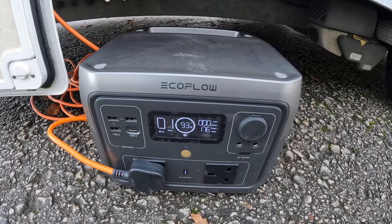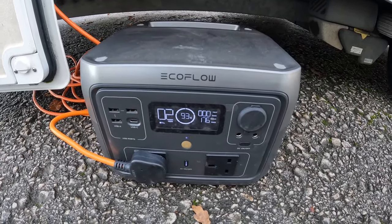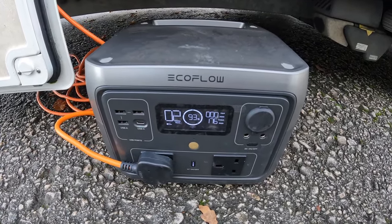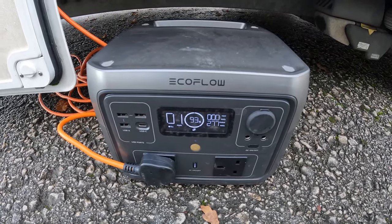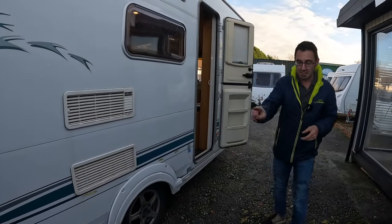I've turned it off, so it should now drop. When I put the fridge back on again — that now is giving us a reading of what the fridge is actually drawing on the wattage. That's telling us that the element in that fridge is actually working.